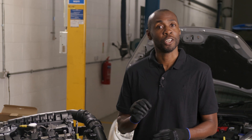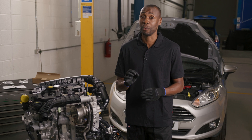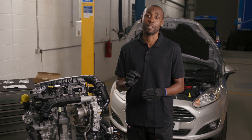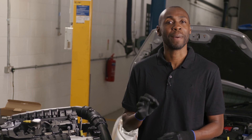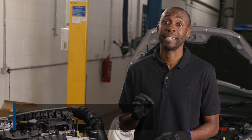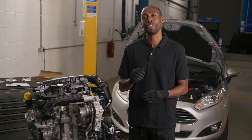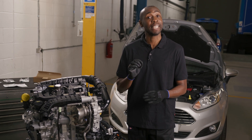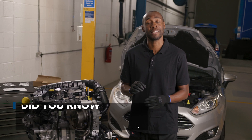You may already know that the high pressures present in diesel systems are dangerous. What you may not be aware of is that GDI systems pose a far greater risk. This is because when petrol is compressed and injected it turns into a vapour-like fine mist and this is extremely flammable. Did you know petrol vapour can be easily ignited with a match even below minus 40 degrees celsius?